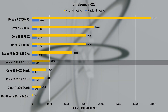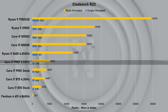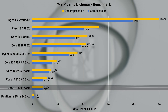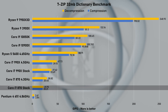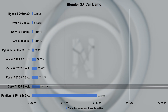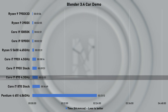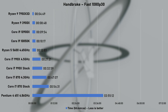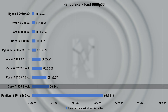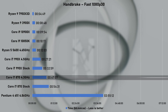The almighty 990X is of course faster in the multi-threaded test — having 2 extra cores helps — but the single-thread score is not that much better, with a difference of under 3%. I cannot wait to test the second generation of i7 soon. 7-Zip dictionary benchmarks scored the 870 with around 21 GIPS, and overclocking only helped with the decompression test. Running Blender's BMW car render demo took the i7 nearly 17 minutes at stock speed; overclocking squeezed that time by 28%, down to 12 minutes. The last test before gaming is Handbrake, using a 10GB 4K video file and a fast 1080p 30 preset. At stock speed this took 54 minutes and 31 seconds, and at 4.3GHz the time was reduced to 47 minutes, a 13% decrease.